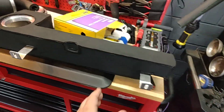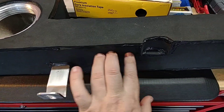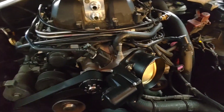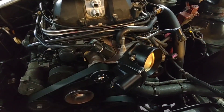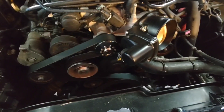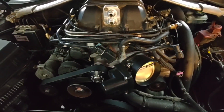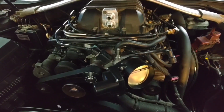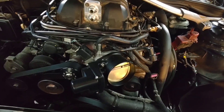We're going to be installing this tank, which I have already insulated and sealed, and we're going to reroute the hoses in the car to go from the tank — which is going to sit right here — straight to the lid, out of the lid of the chiller, back to the tank. This cuts down on a lot of heat absorption I was getting from the engine bay and trunk. I was seeing about a 20 to 25 degree difference in temp from what was in the tank versus what the IAT2 was, whereas a lot of people with trunk tanks see about 5 to 7 degree difference. We're going to see if we can get to that goal.